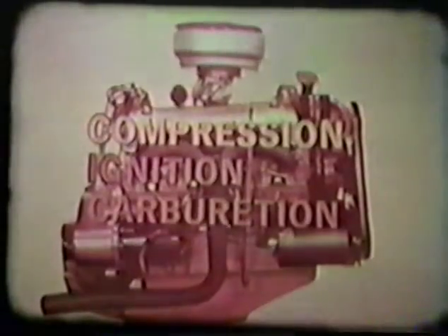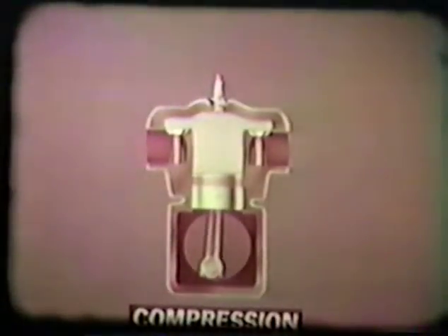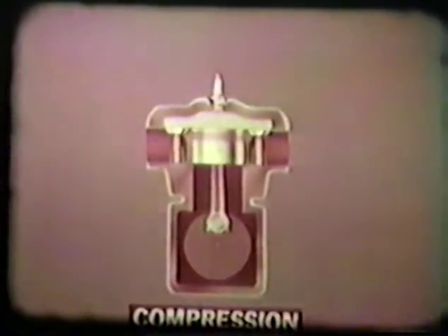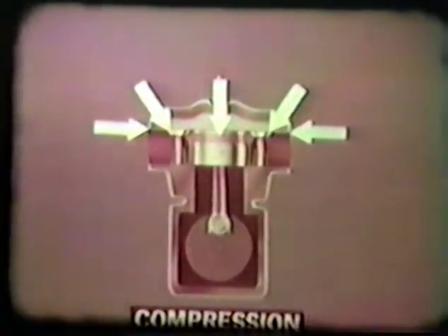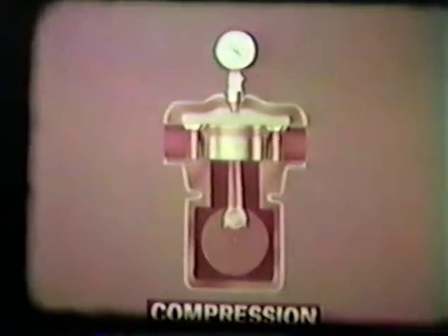Let's look first at compression. Before any engine can be tuned, it must first be determined if it is tunable. This is done by compression testing. You will remember that during the compression stroke of the engine's four-stroke cycle, the air-fuel mixture was compressed to a pressure specified by the manufacturer. If compression pressure leakage occurred around the gaskets, valves, or piston rings, the required pressure would not be obtained and the engine would not develop full power. Compression testing will reveal if an engine meets its specified compression pressure. Failure to do so would render the engine untunable and indicate the need for overhaul or replacement of components.